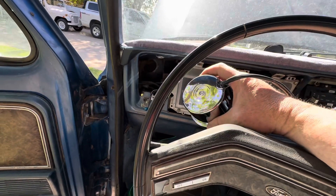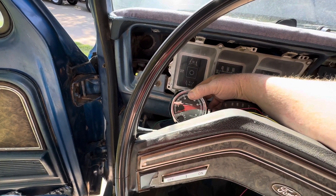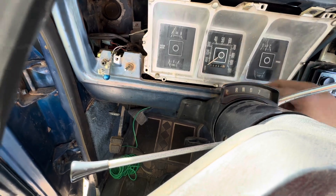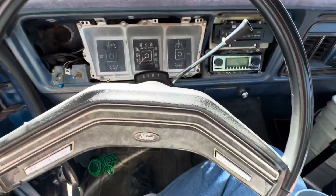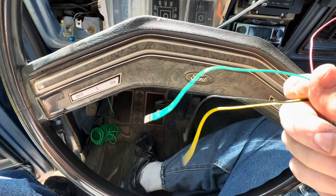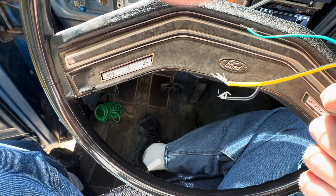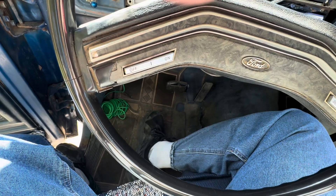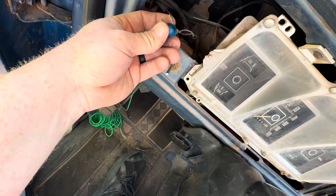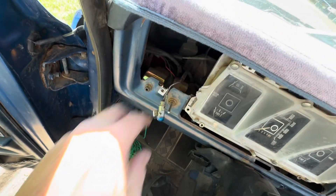Here's the tack. Take the screw out the back and adjust this however direction you want it — I'm going to have it right there, at least not blocking anything. I did pull the screws off of this right here because I'm going to run the wires behind it. Quick wires explanation: positive, tachometer wire that we ran underneath here, negative, and the yellow goes to headlights. The easiest thing I can think of — this right here is the lights. When you turn the headlights on, this will light up, and I'm going to tap into that line inside the dash.